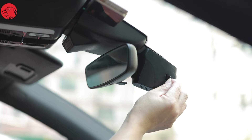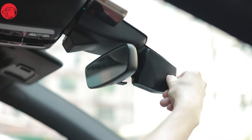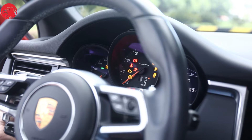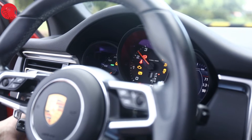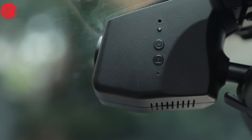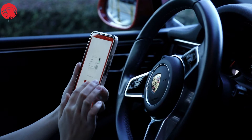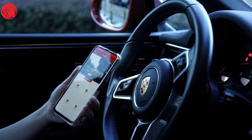For models that need to be divided into two sides with the hands, we suggest inserting the TF card after the recorder is installed on top. Before fully installing the dash cam, test whether it can record normally. Start your car — you will see the blue light of the recorder flashing, which means the dash cam is recording normally. You can also use the MercyLion Viewer app to connect to the recorder and check its working status.